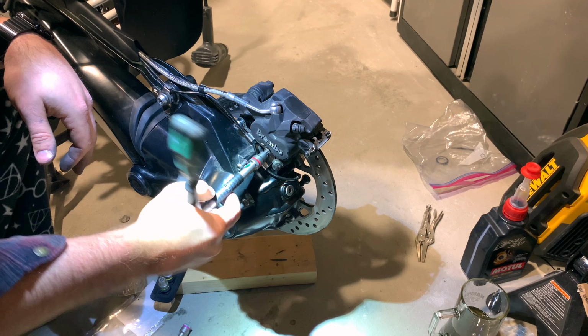So, I'm installing a stronger magnet. I'm lubricating the splines. I'm going to make sure they didn't put more than 180 milliliters in here. And then finally, I'm going to show off a new tool that I've been using for a while now, which I'll show in a second. It's basically a perfectly measured squeeze bottle that actually screws into this hole right here, and it makes changing it super easy. The thing is, the guy makes them at his house. So, I'll link to his ADV Rider thread, but he probably isn't making them anymore. I think it was 20 bucks, so oh well.